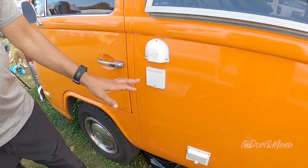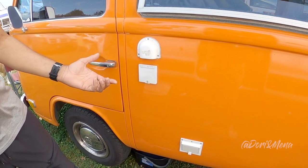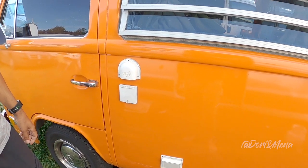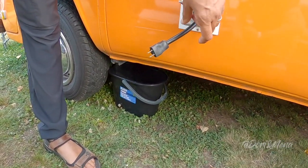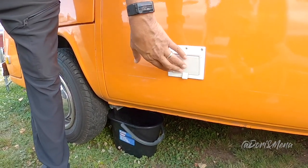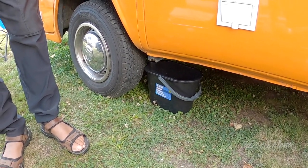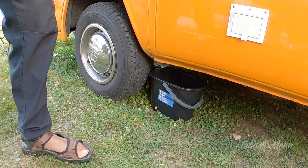Do you need to use a water regulator? No, you can if you want, but it'll hold the pressure — it's regulated. And you can actually pour water into the tank from inside as well for the electric pump. It runs electrically. Here's the shore power — if you plug this in, I've got a three-way fridge. I just put this bucket here to catch the water from the sink when you're washing your teeth. It's your grey tank. It was made for that plumbing, and here's a cap when you're not camping so nothing goes up in there.